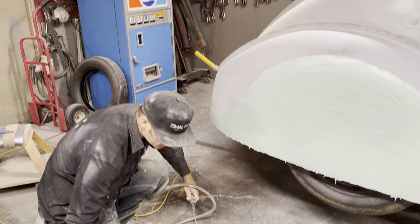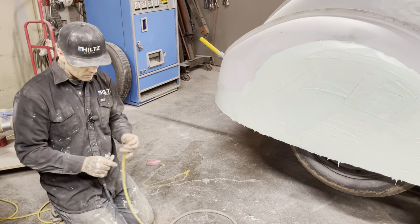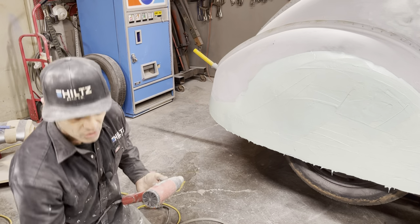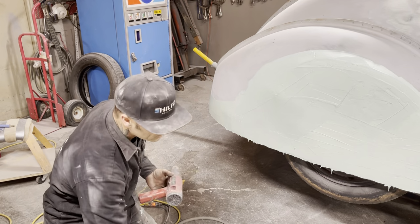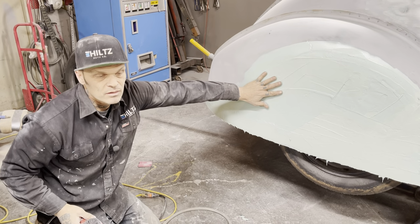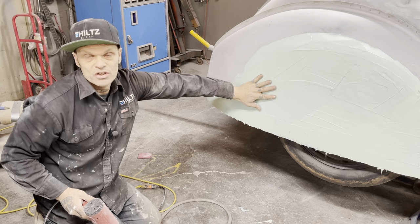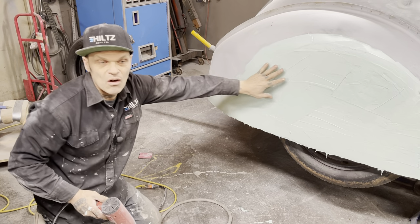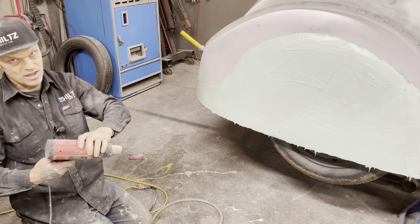Now, when we sand this off with the whole surface covered like that, I will know that it's going well, because I'm going to hold this flat and crisscross it like I would a block. The surface will tell me whatever is sanded is where the water is the highest, and wherever it's not sanded is where the water is the lowest. But we're still on a flood, so I can sand all the places down until I get to the lowest part of the flood, if that makes sense.